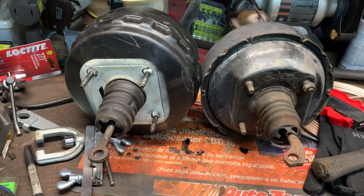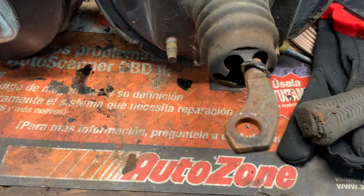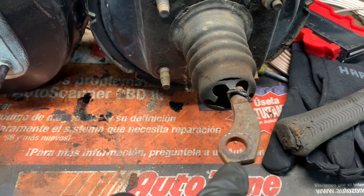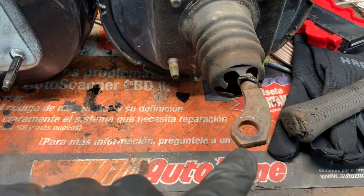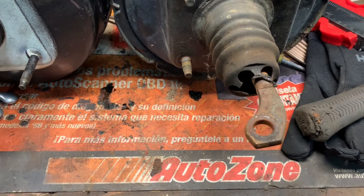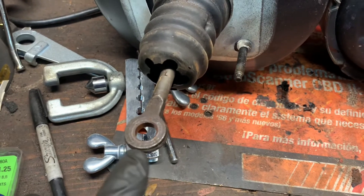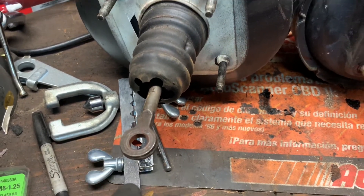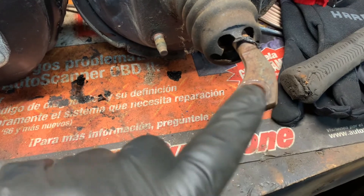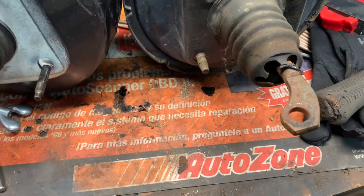Here I have the back of both brake boosters facing me. The original has a little drop-down section and a flat edge — back in '91 and below there was a brake switch that came on that flat area, but in '92 and above they replaced it. So this conversion for '92 and above is a little more straightforward. For '91 and below you'd have to copy that same flat space and accommodate the switch. For '92 and above, the brake light switch is on the rod of the brake pedal, not on the booster.